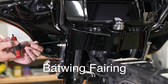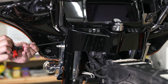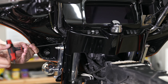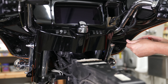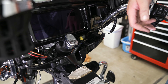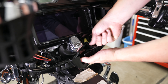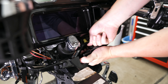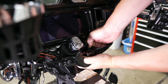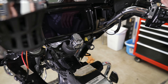On both sides of your lower inner dash cover there is a Torx T27 bolt — left and right side. He's moving around to the other side to get that bolt out of the way. On this stock dash he's going to remove that big plug — it's just a push tab and then you pull it out. You'll have one of those on both sides, plus whatever other accessories you have plugged in.